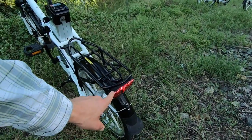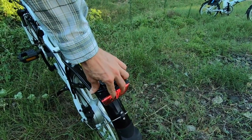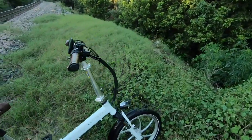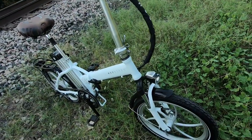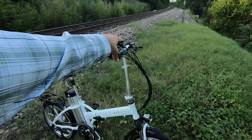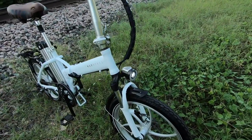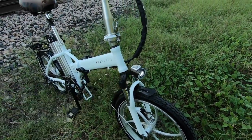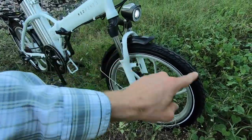I love that they've got wired-in lights. This is the Star Union company — it has two LEDs and a big reflective surface, which is a big win for safety. It also has a pretty bright headlight with a nice beam. It does point where you steer because it's mounted to the arch of the suspension fork, which means it could bounce up and down. I'd prefer the light up higher, but with a folding bike the wires could get pinched. This is what most electric bikes tend to do — put the light down there — and it's a fairly decent light. Also, puncture-protected reflective tires — that's huge.